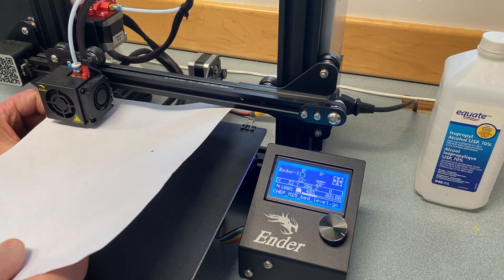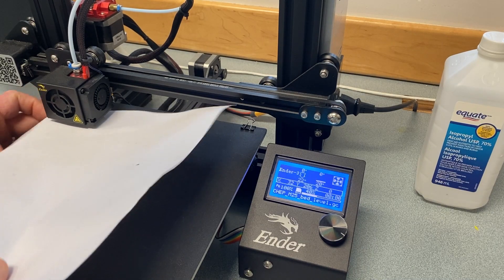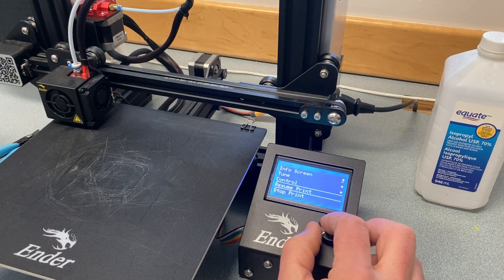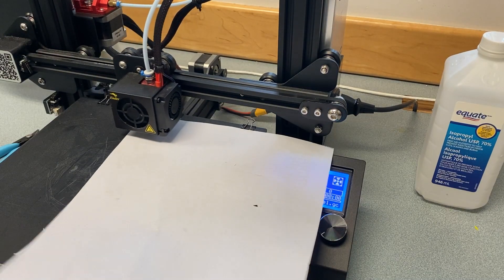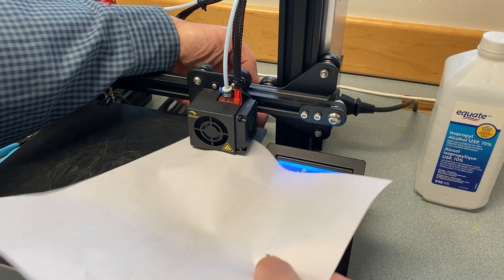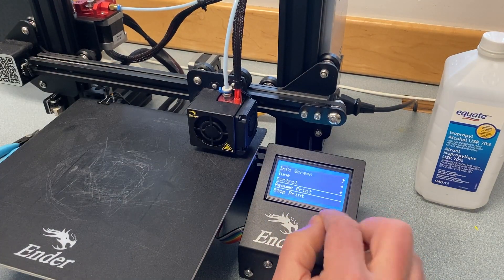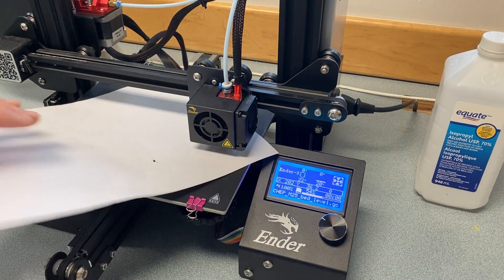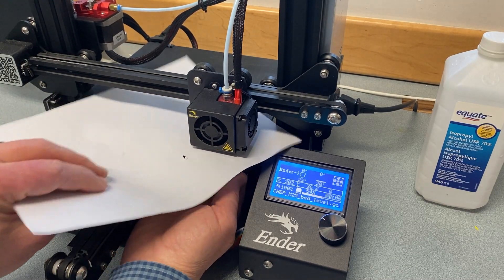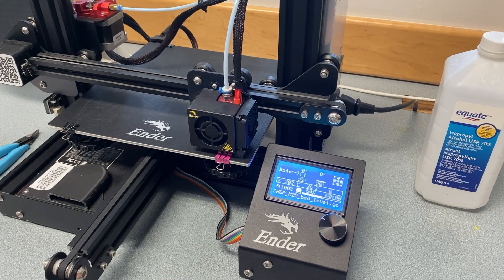This is a little bit too loose. So I'm going to adjust this - there we go. Just so there's enough tension so I can move the paper back and forth without it creasing. We'll resume print. These are a bit harder to reach, these adjusters back here. That one's perfect, but it is in the back. You can see the paper is creasing but I can move it without too much effort. That one is too loose. It doesn't take much in the way of adjustment - I only turn that maybe a tenth of a turn.